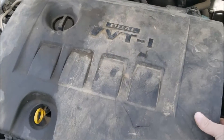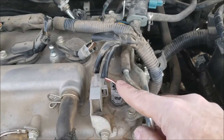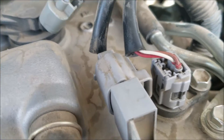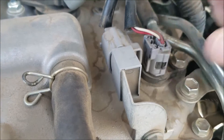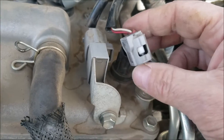The first thing I do is pop this cover off — it just pulls up. And this is the camshaft position sensors, and this is the one we want to take a look at. Right here on the back is a small little clip and I just use a small screwdriver. I barely pull out a little bit on one side and then pop it up, so you don't break the clip.